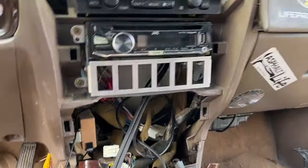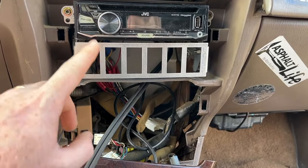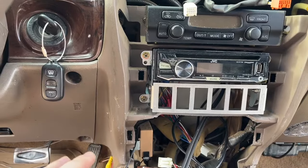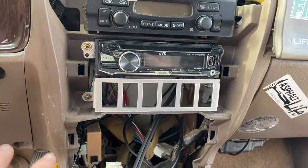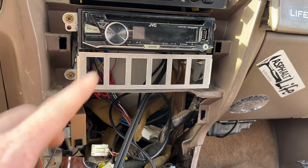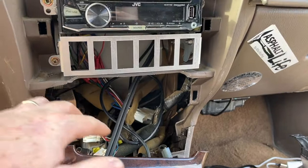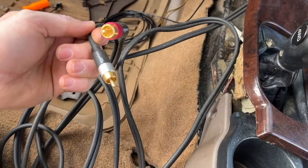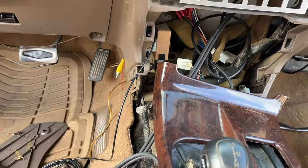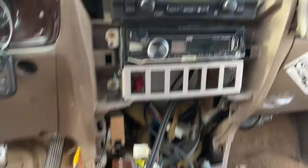We're back — gotta bolt it in on four bolts on each side. I'm gonna link the switch bank in the description so y'all know what it is. I had a problem on the last 4Runner running the power — I ran it down under the mat and it looked a little scrappy. If you know a better way to wire a switch bank, let me know in the comments. Got the RCA channels in there — Amazon basics but I really like them. Got my power antenna wire for the amplifier on the sub, and I'm just gonna zip tie these together and go along the tunnel.